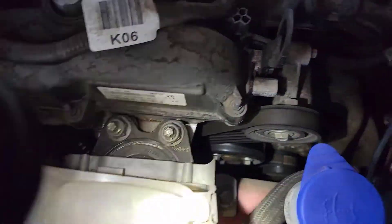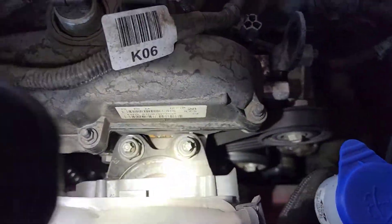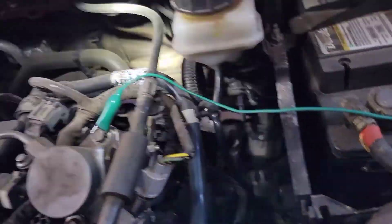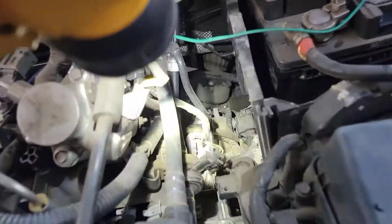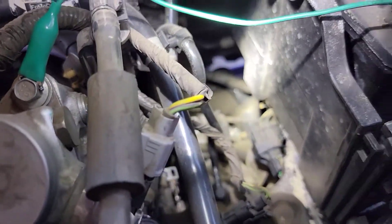But there's usually some of those flexible ground straps somewhere — usually they're kind of in a logical spot, like across frame to engine somewhere. There's our motor mount. Don't see one yet. But maybe I'd see it underneath if I took the diaper off of this thing. Anyway, I might just pick a bolt or a spot to add a bolt. Looks like there might be some spots right there. I might just add a ground strap right up to here, since I'm going to take that off anyway.